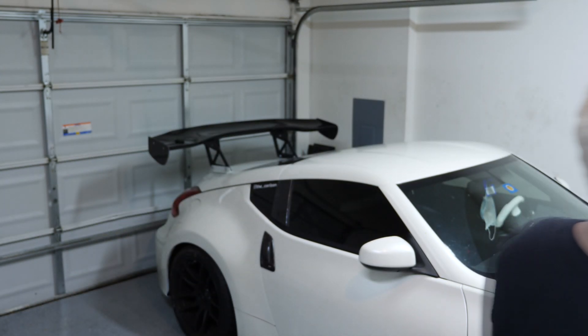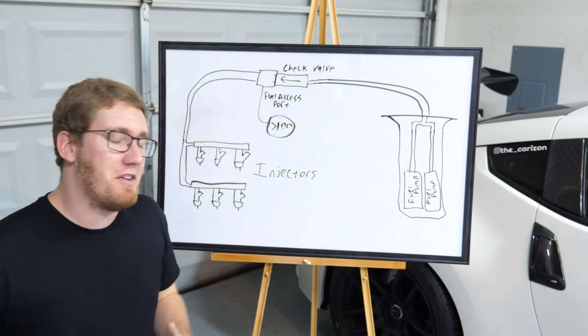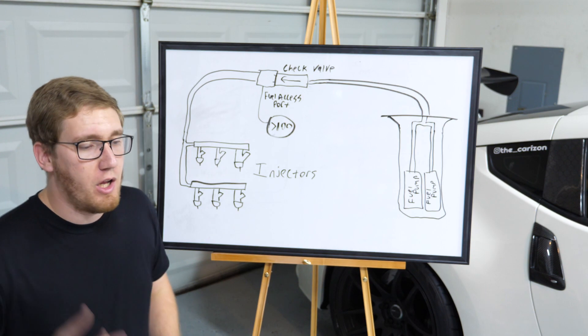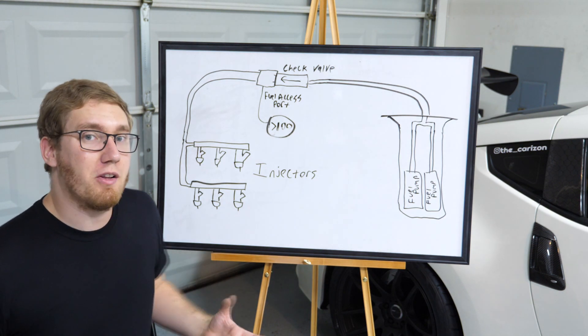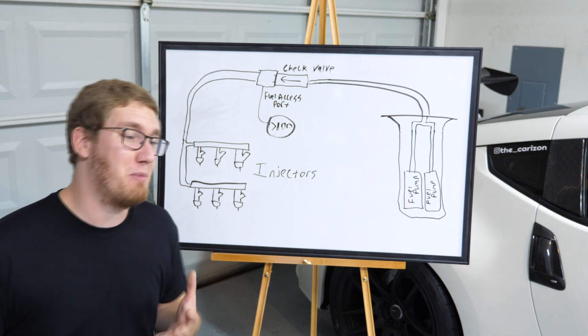This is clearly a fuel pump issue, probably related to the relay box — we'll debug that in a second. The second issue: after running the car for a while, if I shut the engine off and waited 15 to 30 minutes, I wouldn't be able to restart it. And looking at my fuel pressure gauge, I found the fuel pressure could go upwards of 100 psi.